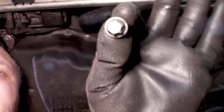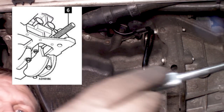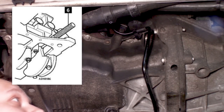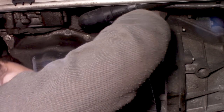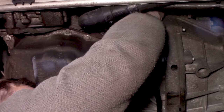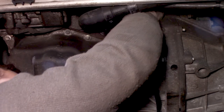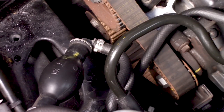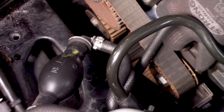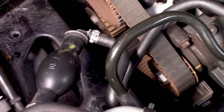Here we have it. So now we have one of these pins. And we can just screw it in there. But only after we set the crank to dead center. Okay, what I do in these kinds of situations is just mark the crap out of it where it's located right now and try to put it back the way we found it.